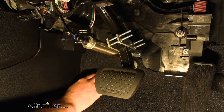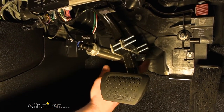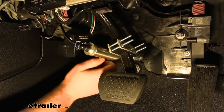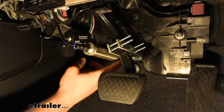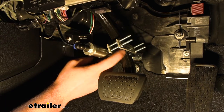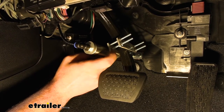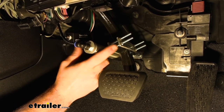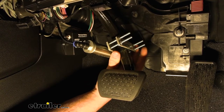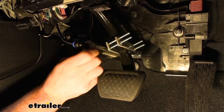Back inside the vehicle under the dash on the driver's side, the airline tube comes down and connects to the cylinder. The cylinder gets bolted to your brake pedal arm and then anchored to the firewall — this is what actually activates and pushes down the brake pedal when the system turns on. The kit comes with some screws pre-installed but they're a bit short, so I switched them out with the longer ones that also come in the kit. Clamp this onto the brake pedal arm about three fingers up from the pedal — low enough for leverage, but not so low it's in your foot's way while driving.